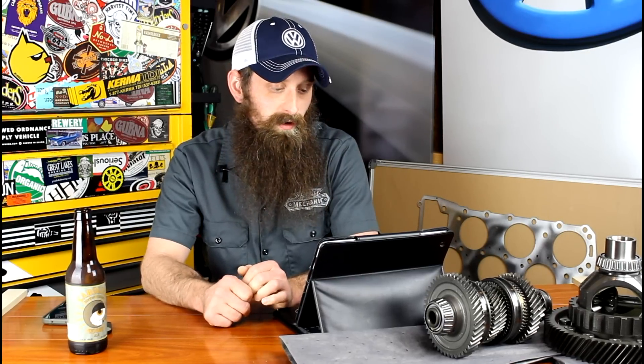Manny asks if the DSG is patterned after Porsche's PDK in any way. PDK is Porsche's version of a dual-clutch gearbox and it's actually very similar to the DSG — probably about 80% the same design. Paul asks if he should replace the trans cooler at the same time as a clutch pack replacement. Probably not, unless there's fluid contamination — cross-contamination between coolant and gear fluid, or metal in the system. If there's metal in the system you're really looking at replacing the gearbox, but otherwise I wouldn't replace the cooler at the same time.